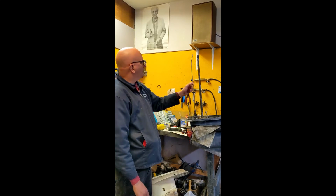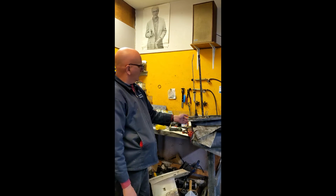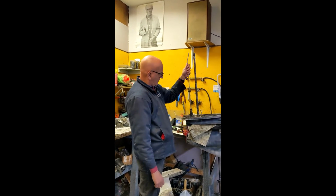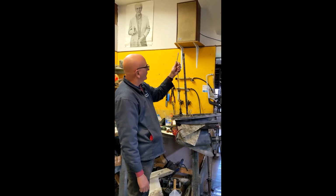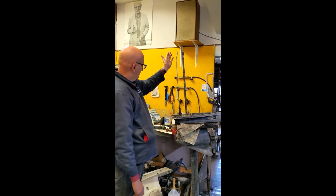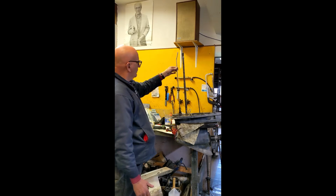I really thought you'd be interested in this. Obviously, the owner of this motor would be interested. This is a shift shaft. This goes up and down to shift the motor from forward to neutral to reverse. It's supposed to be straight. I said, well, that's bent. And of course, we ripped the whole motor apart to rebuild it.